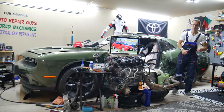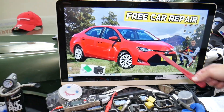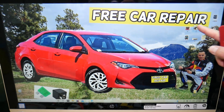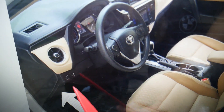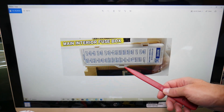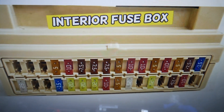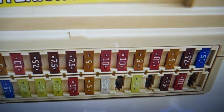The fuel injector fuses — where you can expect to find them. We will demonstrate on that generation Toyota Corolla right here. You have multiple fuse boxes; today we'll work in two of them. The first fuse box is on the driver's side. Open the door, look under the dash on the left side — look upside down — and you will see a white cover. Pull that tab underneath it, and once you open it you'll find the main interior fuse box.